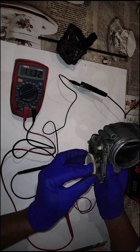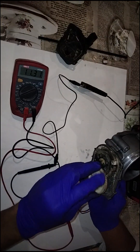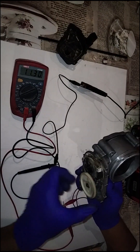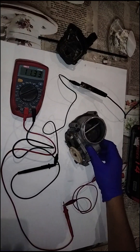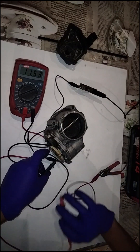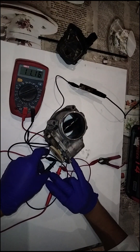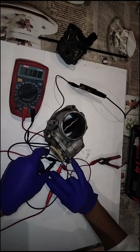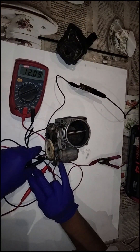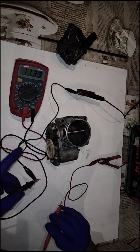You can see here there are two points which act as stoppers. When you push the pedal flat, the gear moves to the farthest point and touches the stopper — that is where it stops, no matter how much power is going to the motor. There's also one at the bottom so it can't go lower than that. So let's determine which side is positive and negative and connect the two terminals. We got it right the first time — we can see it opening, all the gears working perfectly fine, and it's touching the stop point.